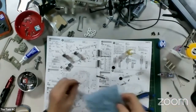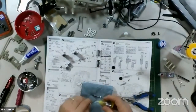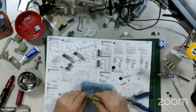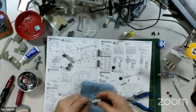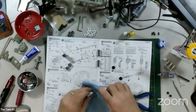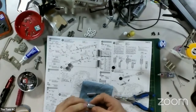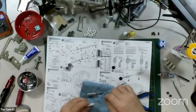What about gel lube or... No. You want a regular electrical oil. So no WD-40 products? WD-40 is a cleaner. It's not an oil. It's not a lubricant. It takes all that oil and grease and gum out of there. They do have one version of WD-40 that is an oil, but you've got to be careful and read it. Most WD-40 is a degreaser. When you read what it actually does, yes, it eats rust and things like that, but it is written as a degreaser. It's true, they do have many products now, WD-40.